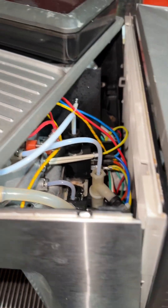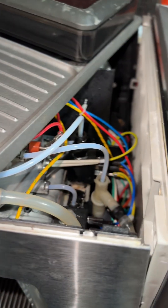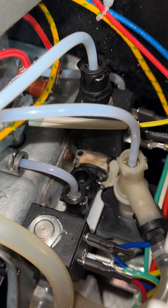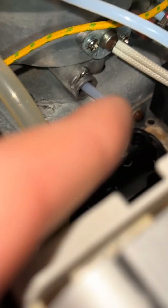Hey Jacob and Lizzie, here's your machine. I had a look inside before I turned it on and there was moisture inside — it was indeed leaking water. You can also see some signs of corrosion on the solenoid valve over there, and some pitting around the bracket over here.